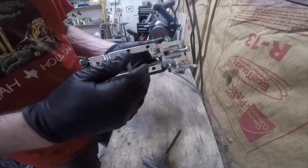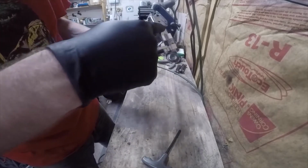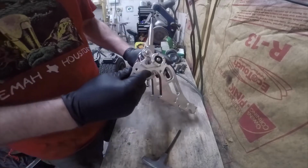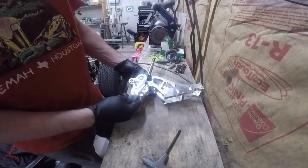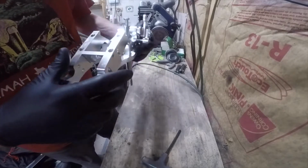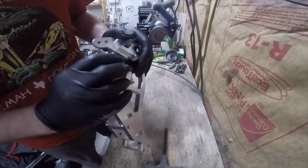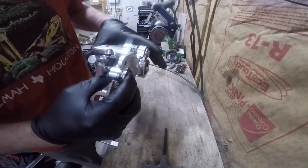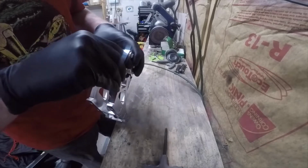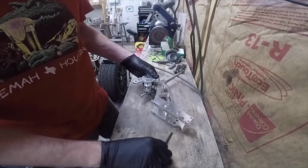So it's clear there's 2 big rails which are held by, looks like, 4 sets of cross rails, and then this piece of linkage here is obviously the most complex thing to work out. There's a spring that goes around that pin right there, and it looks like you can remove that pin and pull it out so you don't have to try and muscle the spring in, which is really nice. So I am going to go ahead and pull that first.